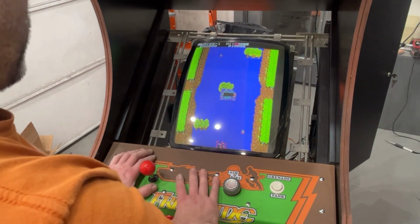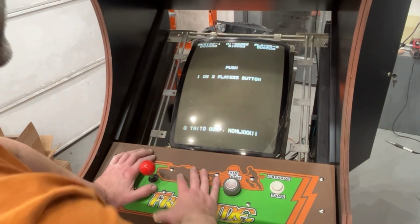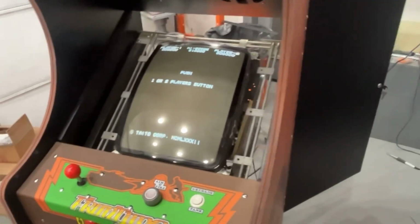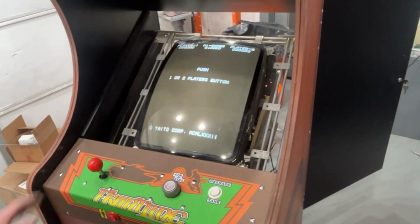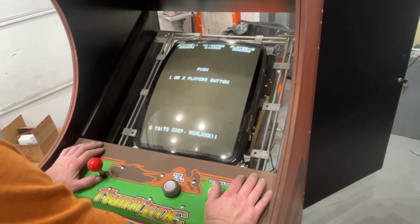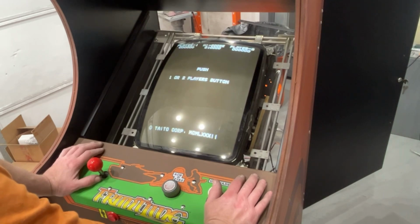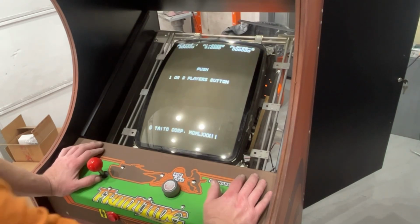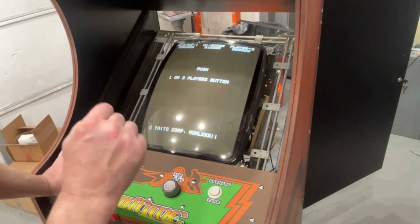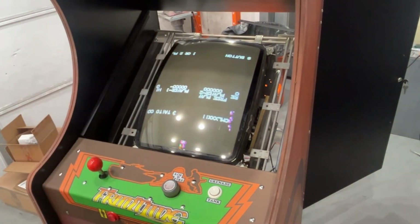I think it's got something wrong with the board, but I can reset the ribbon cables, stuff like that, and see if that does anything. Take the socketed chips and pull them, clean them, and put them back in. Right now we're at about 5 volts, and the screen's shaking a little bit. For some reason, it can't handle the 5 volts. And I'm measuring it at the power supply, which means in theory it should technically be lower at the board itself. See how it's just freaking out?